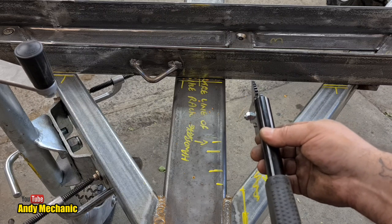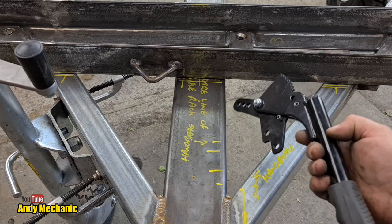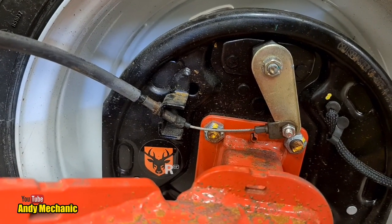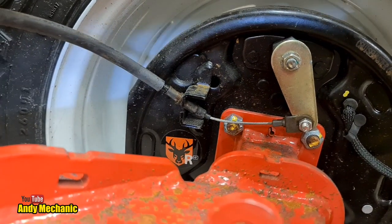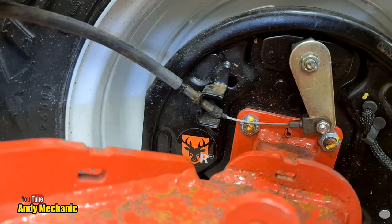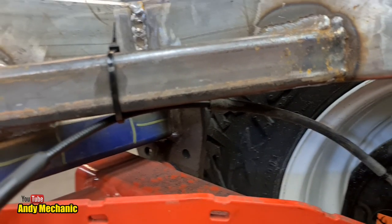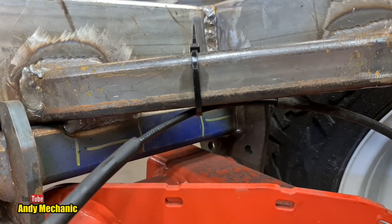But they look pretty good. I have jerry-rigged one at the moment, so we can go and take a look at that now, and then we'll do some fabrication work. Right, so you get a rough idea. I've put a bolt through on the pivot for now. It's just an M6 bolt, and sat in the bracket is the outer cable. Obviously that needs an extra piece, a spacer made on the lathe. And then it comes up. I've just got it zip tied because cable routing is pretty critical as well, so I've put a temporary cable tie on there to see where it sits.